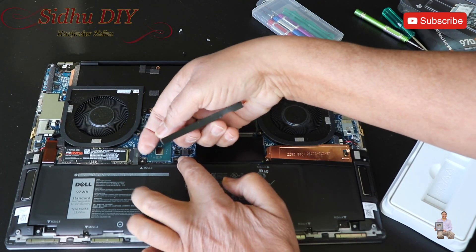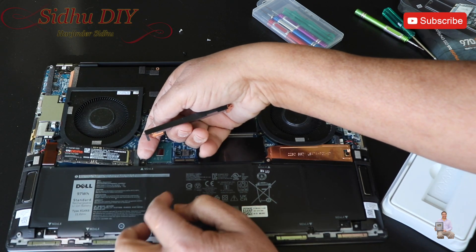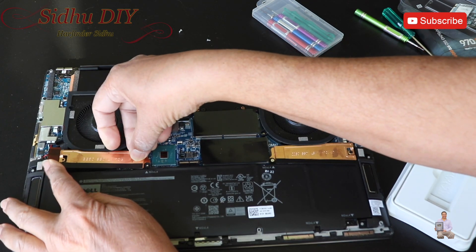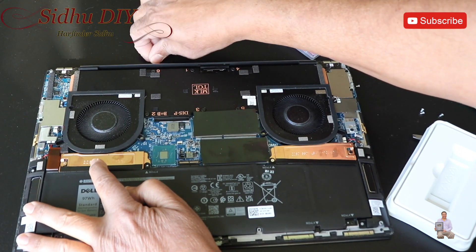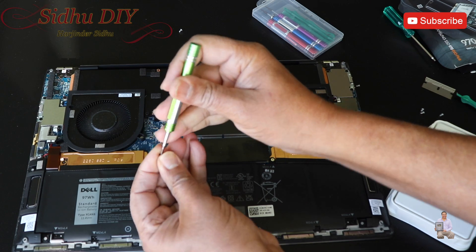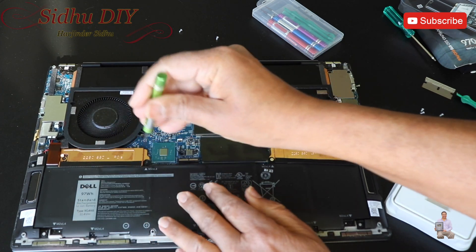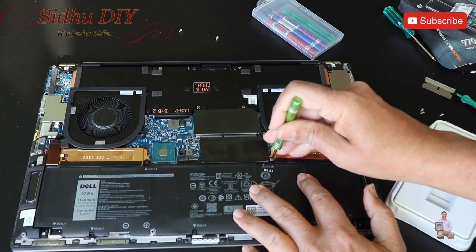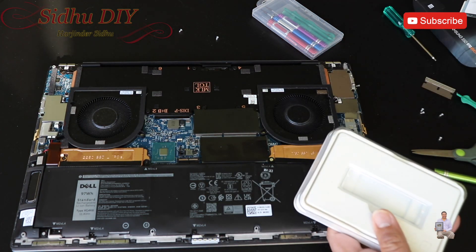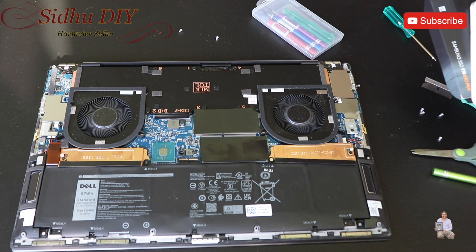This is the cover. Same thing — we're going to pull the battery up just like this. You don't have to apply any force. You just lift it a little bit and it will slide underneath. This is it. Now we're going to put the screws back in. Once it's tightened, we're going to get the second screw that goes inside right here and tighten it. Please don't forget the one screw on the side of the battery which we loosened — tighten that also. That's how easy and simple it is to upgrade your SSD.